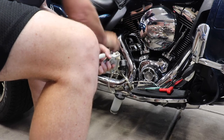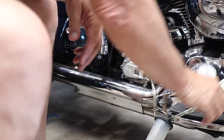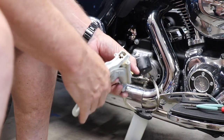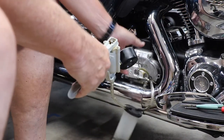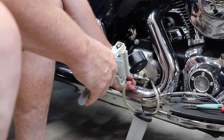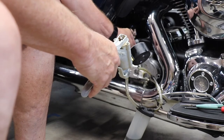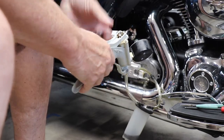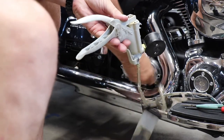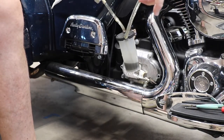I'm going to close it and go check my reservoir. I filled up a little more of the reservoir. I've still got some pressure on the line right now. I'm going to pump it up a little more and open up the bleeder again and watch the fluid — when the fluid looks clear, we're in pretty good shape. It's looking pretty good right now, so I'm going to close the bleeder up. I'll release from the bleeder — and that's all the dirty stuff that we've got.